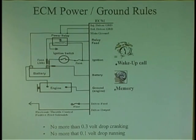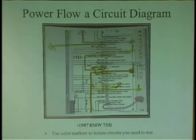Same thing goes with the throttle bodies now. These electronic throttle bodies. How do you think the computer, when you get high current circuits that any computer is going to control, where do you think it gets this power and ground? It's got to send power and ground out, right? Sometimes they'll put a dedicated fuse feeding the computer to feed the driver because it's power and ground fed. So the guy replaces the throttle body, replaces the computer. Meanwhile, it's a blown fuse. Already been there. So these are new things now. Driver feed fuses. Something to think about.